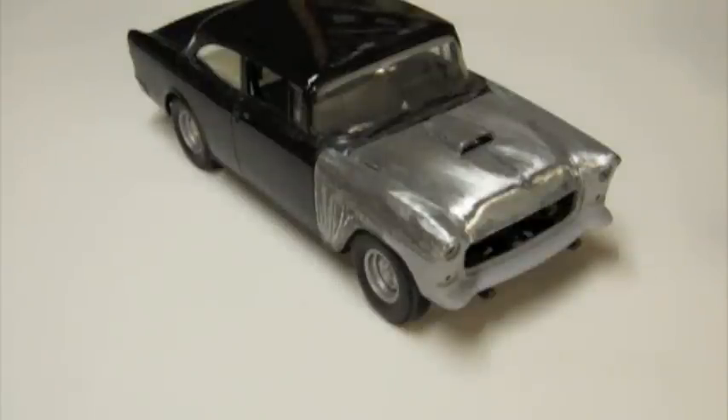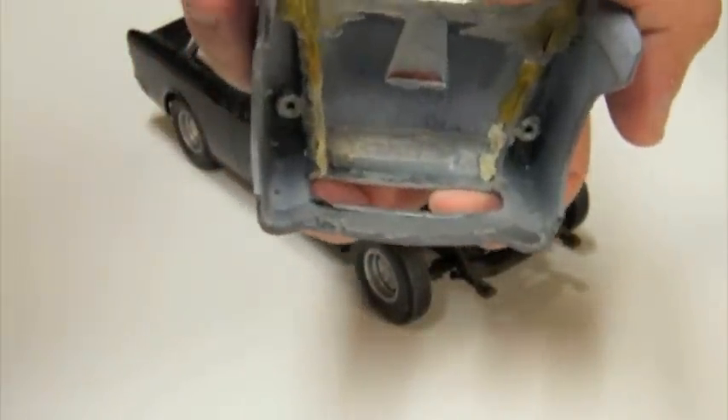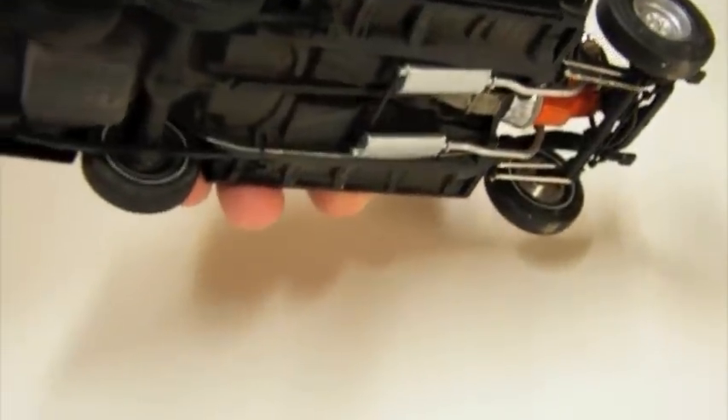As you can see here, I started work on the major difference between the stock 55 and the movie 55, which was the flip front nose. I had actually gone through and sliced off the front fenders, glued the hood in place, epoxied everything together, cut off the screw mounts, and removed everything under the hood — the inner fenders, the stock firewall, and so on. I also supercharged the engine, which although it wasn't shown or mentioned in the movie, the script did mention that it was supposed to be blown, so I just decided to throw that in there as a fun extra. I also converted the front end to a beam axle, got the whitewalls turned in, and the supremely shortened exhaust system.